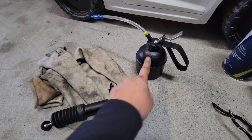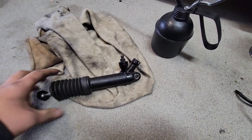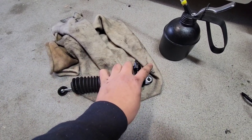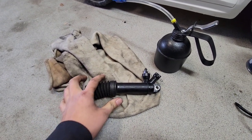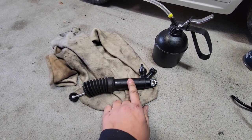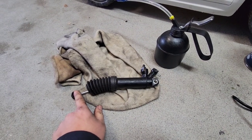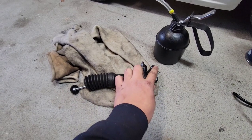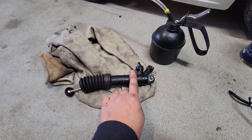Slowly pump brake fluid into the clutch line port on the slave. But before you do that, compress the piston by pushing the rod in. Then insert fluid into this section slowly and continuously while you let the rod end of the slave come out — basically it's sucking the fluid in. Pump in fluid slowly as you let the piston rod come out. Then you can pump out the air bubbles by slowly pushing the rod — air bubbles will come out until only fluid comes out, meaning the slave cylinder is full of fluid rather than air.